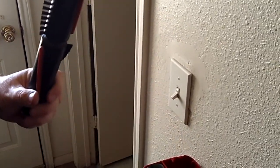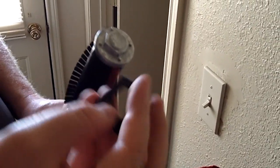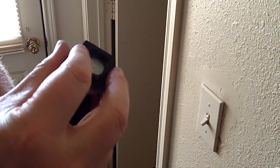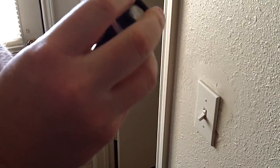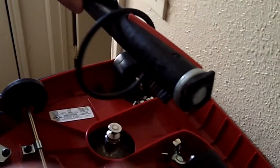Then you do the other side the same way. Slide it on, make sure it spins good. Then you make sure you keep the little hex pattern on here up to the outside, and find a place to align those pins. Set them up. Okay. Now when you're putting this in, you can see it's kind of got a little chevron shape to the outside edge here, and it is pointed at the top and it's flat on the bottom. So you want the pointed side to go in, and you want to make sure you line both of them up the same way. And throw your belt on, and the short side goes to your right side when you've got it upside down like I've got it.